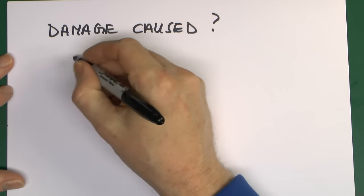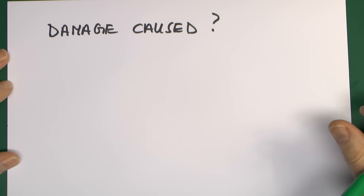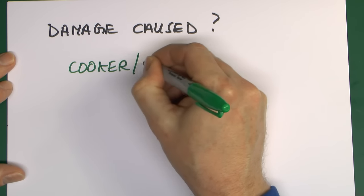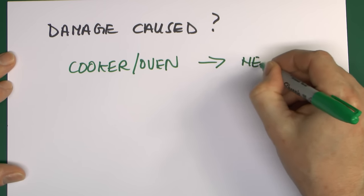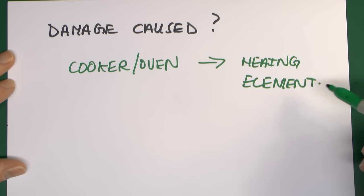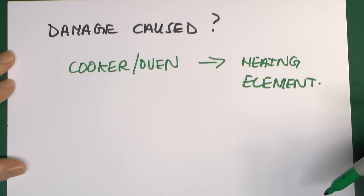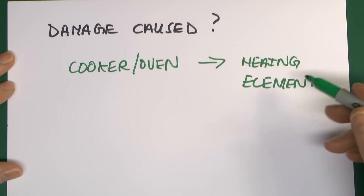If you look at certain older equipment in a typical house a few decades ago, you would have things like the cooker or oven. All that was in there was basically a heating element — in most cases several of them — but it's just basically a resistor inside a metal casing. Shoving a fairly high voltage on that for a fraction of a second is probably not going to do any damage. If it was high enough or long enough, it could theoretically arc over to the earth casing and might cause some damage, but that's pretty unlikely.